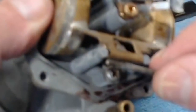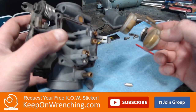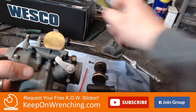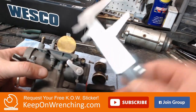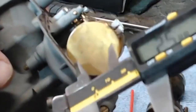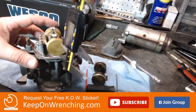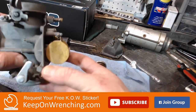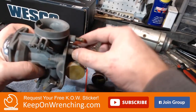There's a little pin I took out earlier that holds that float in. That's the adjustment we need to make, and here's how you do it. The mistake I talked about in the short was that people will adjust their float height — which on this one is 26 — looking at it vertically. There's just a little bit of weight that can close that valve and you can be off one or two millimeters. So what you really want to do is look at it from the side. Hold it up in the air and get this thing nice and loose and kind of flopping around.